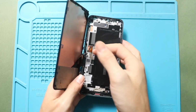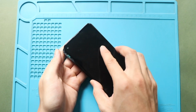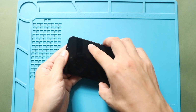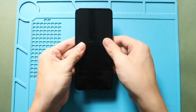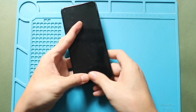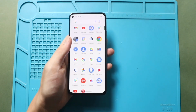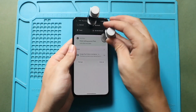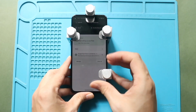Gently slide in the screen from the top to the bottom. Slightly apply pressure on the screen edges. Finally, we are adding binding clips to fasten the LCD screen. Leave it for some time and remove it. If not, use some rubber bands to tighten the screen to the body.